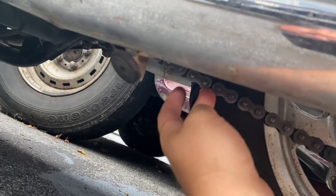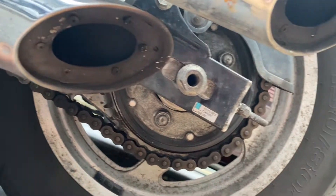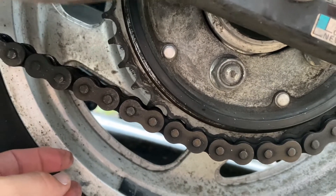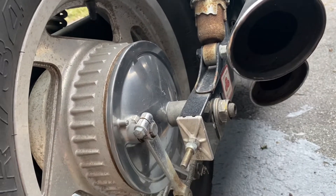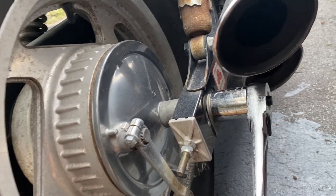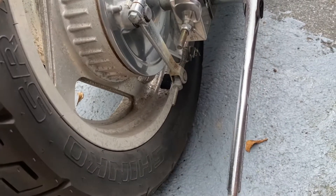I'm going to adjust it enough to have an inch of play. Chains do wear and they do get tight spots — that's normal. My sprocket still looks pretty good, hopefully I can get this thing back in service. I'm afraid the chain might just be worn out, but I'll adjust it. The axle nut I believe is a 27, but I've been using a 28 and it's been working to loosen it. I'll open this up and then adjust these little adjuster screws — I believe it's a 14 on the adjuster screw.